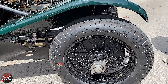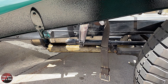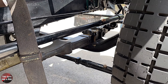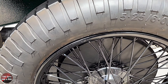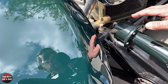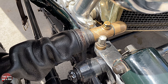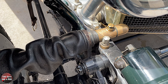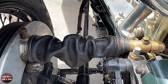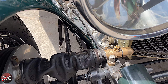I can tell you it's a challenge to stop them. All the brakes on this car are mechanical brakes - there's mechanical linkage to all the brakes. Perhaps if you want to bring the camera around, I can show you the return spring on the brake. It's this coil spring down here - that's actually the return spring, so they're in a leather gaiter there. There's basically a dumbbell inside the actual brake shoes, and the mechanical brake is actually rotating that dumbbell which pushes both brakes forward. So they actually grip.